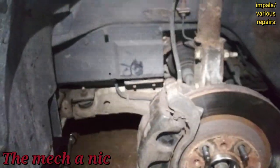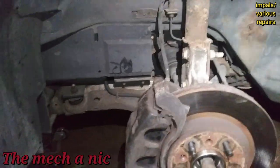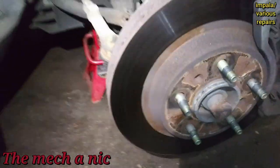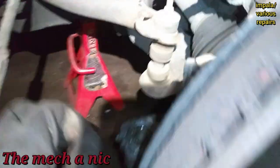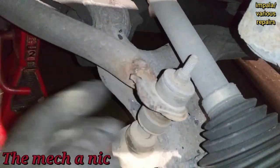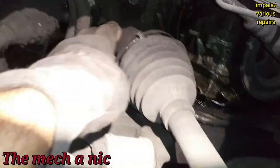I don't have an excuse for missing the control arm bushings the first time I was inspecting this car. It's going to need lower control arms — that's for a different day. Now I'm on the right side, disconnected the outer tie rod. You can see the broken sway bar piece on this side too, and here is the CV shaft we're going to be changing — you can see the clamp isn't doing anything and all the grease has been thrown out.